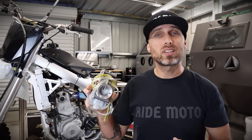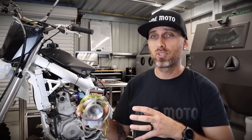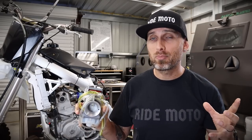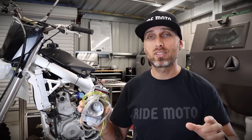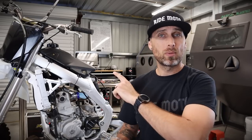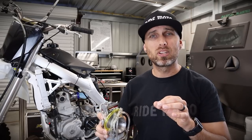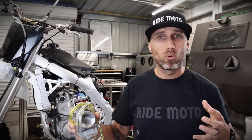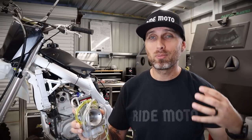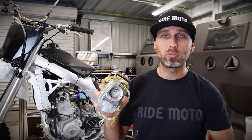When we get a custom order, we will set these up at the factory — literally build them for your bike — for your exhaust, your fuel type, your style of riding, your base elevation. So most of our guys, 99% of the time, don't even need to mess with the settings. They simply set the idle and go. Once in a while, we'll get a guy that has a special bike or something like this that is uncharted territory — maybe they need a big bore kit, port polish, or something fancy — or maybe even the reeds are worn out and the bike doesn't run right. But at any rate, these are plug and play for the most part, and we're really proud of that.